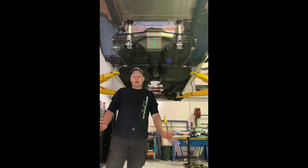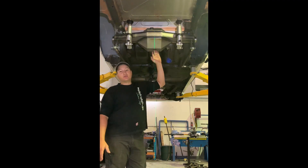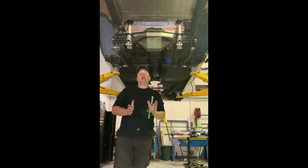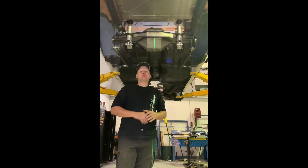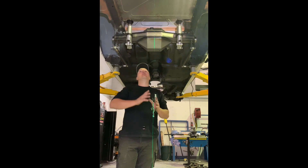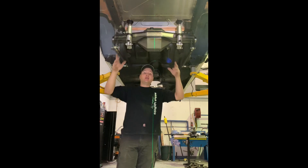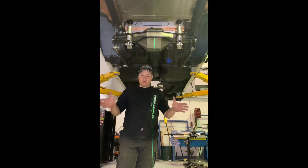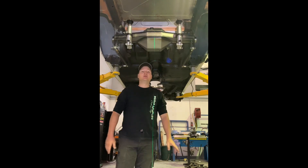So the way I set them up is — as you can see — I've got my laser chalk line set up and I'll measure everything off the centre line of the car. Before we even start, we'll pick up a centre point at the very back of the car. Remembering the earlier video, take a couple of measurements because you don't know the history of the car. On a Commodore, I'll measure between the boot openings, the taillight edges, just a few different places, and make sure all of those measurements give you the same centre line. That's the rear.